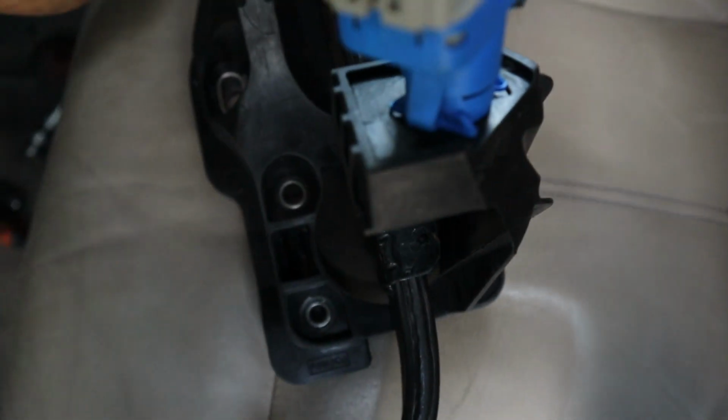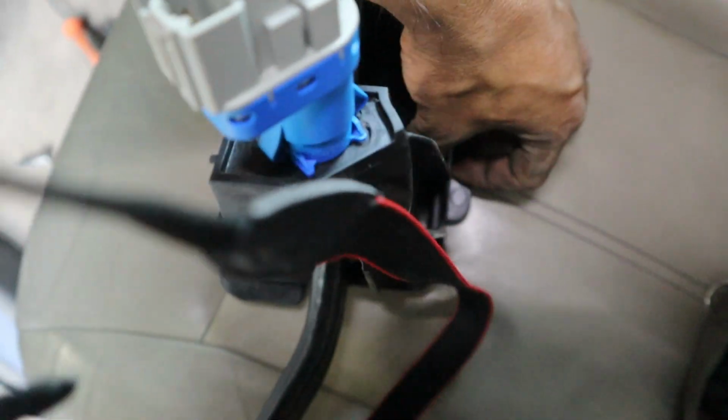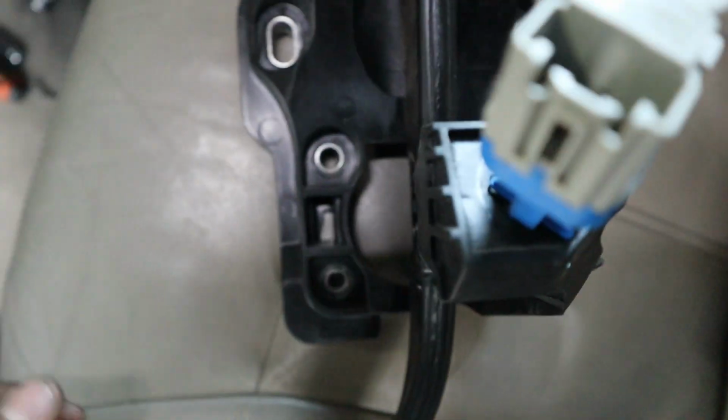Disconnect the booster, and then I'll get that out, and I will get to the actuator to pull off the actuator and see if the door is actually operating properly, and we'll go. So there's a trick to it. So once you get the 4 brake booster bolts off, nuts, you still can't get it out.